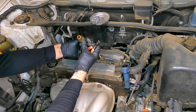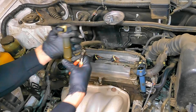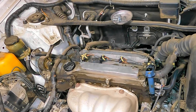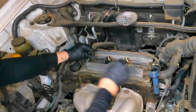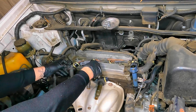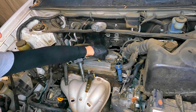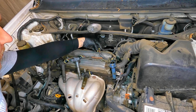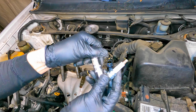I do like to use dielectric grease when reinstalling everything — I'll show you where and how to use it later in the video. It is really important that you torque down everything when you reinstall all parts on your engine. You don't want to over-tighten something, especially the spark plugs, and lose the threads. That is a whole other task to defeat, so don't get to that problem.